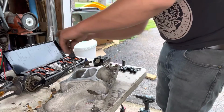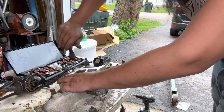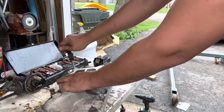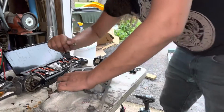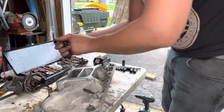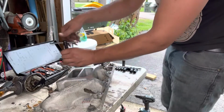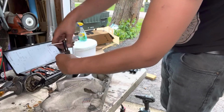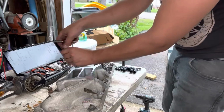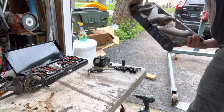And when you're working the tap through, you want to oil these up a little bit. I did that prior to turning the camera on. Just work your way down, forward, back, because you are cutting new threads for the insert that's going to go in a second. And this is really not that deep. Back this out of here. Flip it, take the aluminum shavings out.